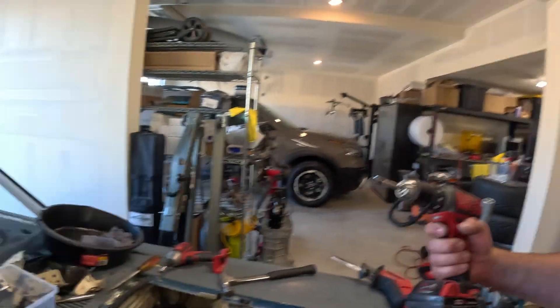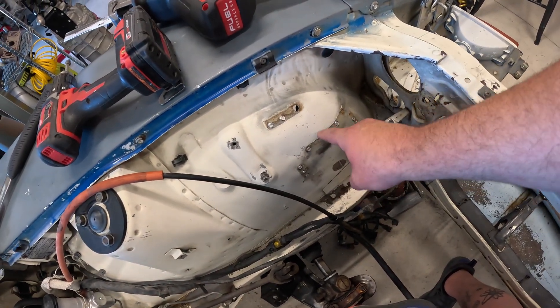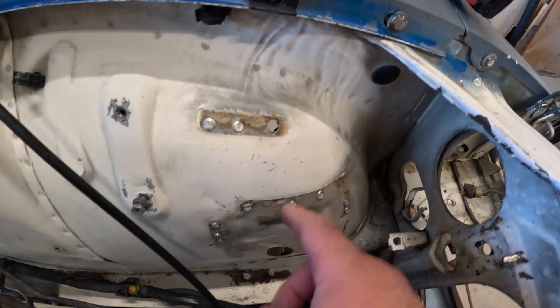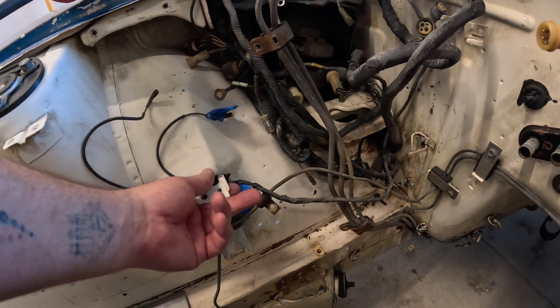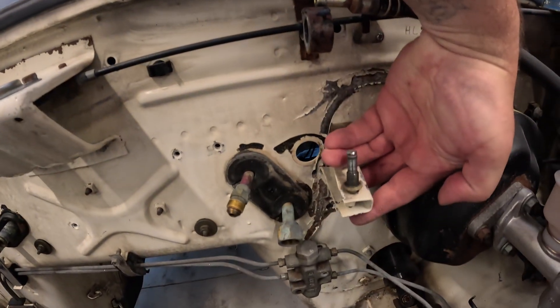We should be in pretty good business. I've gone kind of wild with this cheap little spot weld cutter from the factory. You can center punch them and then use this drill — a little tiny hole saw basically. Take them out, and then I'll have to grind them smooth. This was one of the first ones I did and I went right through the sheet metal. Luckily, on everything else I've actually done pretty good. I'm probably going to remove most of the rest of the bracketry in here — I don't think I'll need any of it. Worst case scenario, I'll make new ones. Same thing down here, kind of drill all these out. Same thing with the throttle linkage — that'll come out.